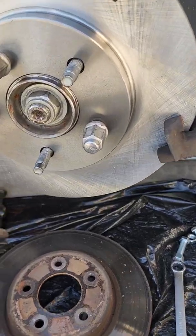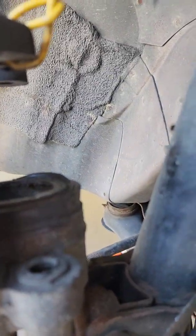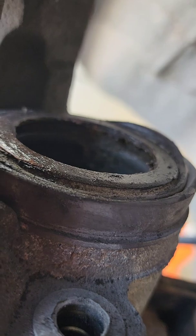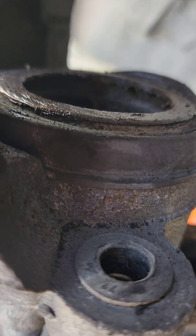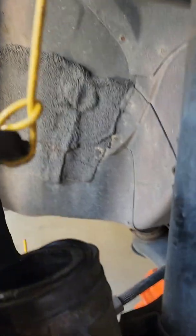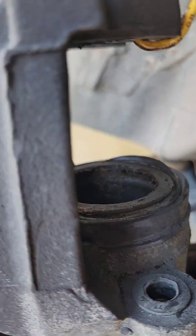I've seen a lot of guys, including myself, put that lubricant on the back of the pads themselves. But more recently, I've just been putting it on the caliper. That's where it's going to rub on the brake pad. So that side, and then the other fixed side, it's like inside here, right around in here. It does the same thing as putting it on the pad, but I think it's a little cleaner because it's only going where it's needed. So that's what I do.